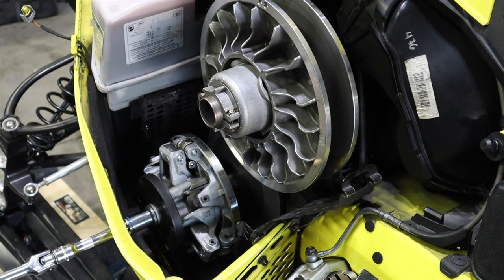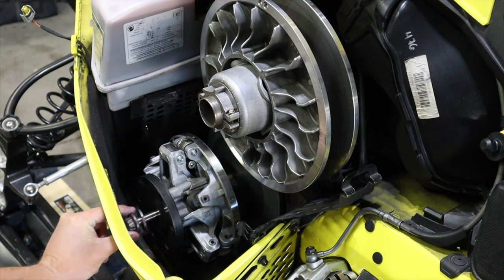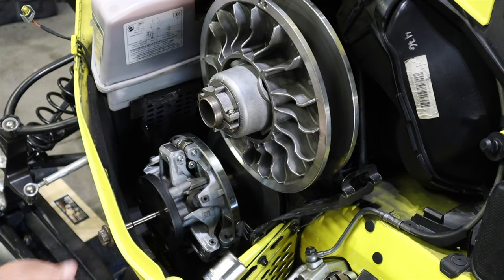And then I'm going to take my breaker bar with my 21 and loosen my clutch bolt just like that. Here's maybe pretty tight. I think torque on this is 40 foot pounds or something like that — I'll look it up and give you guys the correct number. So you'll back it out, it'll get loose, you'll pull it, and then it won't come out anymore — you have to start threading it out again. Don't be the guy that starts yanking on it and banging on it.